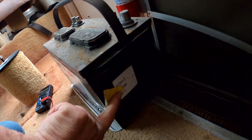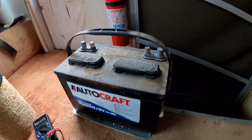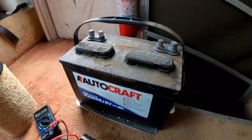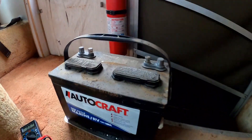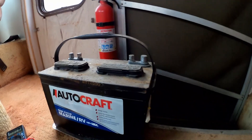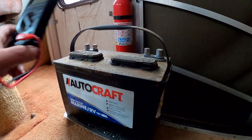I got the battery out and just as I suspected, it is indeed an older battery and it's losing its ability to hold a charge. The date on here is September of 2017, so it's at the end of its life. On average, you should get about five years out of a battery, give or take depending on how well it's been looked after. It's been abused and overly discharged too many times, which certainly affects its lifespan.